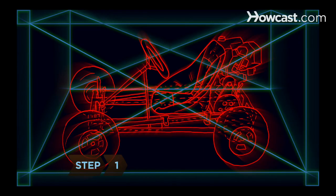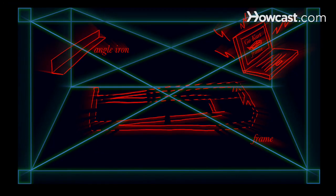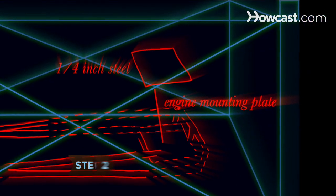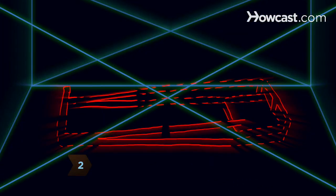Step 1. Search the internet for a go-kart assembly diagram and construct the go-kart's frame from angle iron cut to size. Weld the pieces together to form the frame. Consider purchasing a go-kart kit and assembling the parts in it according to the manufacturer's instructions. Step 2. Form the engine mounting plate from quarter-inch steel plate and weld it to the frame.